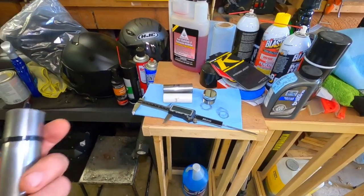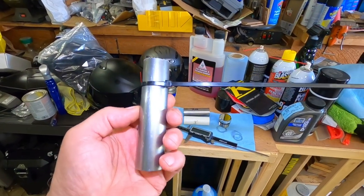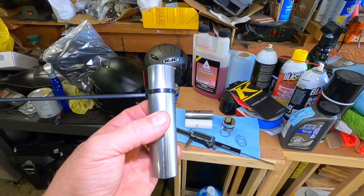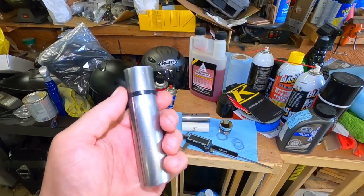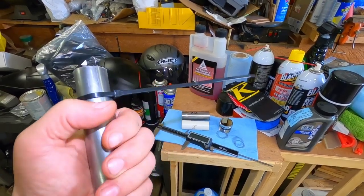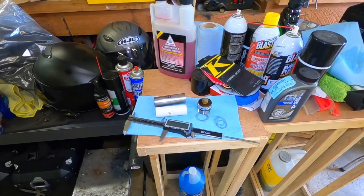Another little tricky thing: I made this slightly over three and a quarter inches. Take a Sharpie and put a zip tie on it if you don't have any other means. Put a zip tie on there — the zip tie makes it square. So I just take a Sharpie, walk around there, make my rough cut, then go over to the grinder and finalize it.